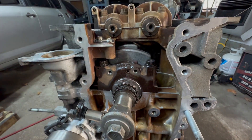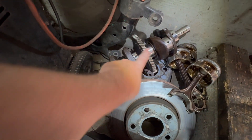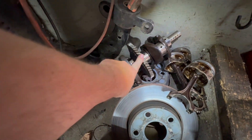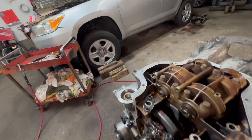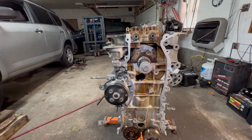There's a big gear. Let me show you on a scrap piece here. This is a crankshaft — you see this gear right here? This gear drives the counterbalance. So that has to be in line and it can't be off, because you'll get a serious vibration when you put everything back together.